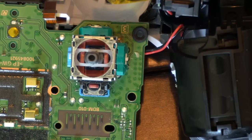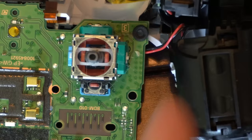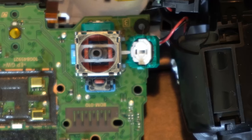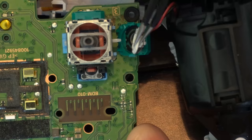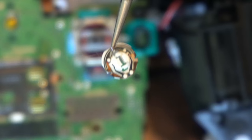I have just this small plastic guitar pick-looking thing that is great for creating some separation and opening this up. I'm just going to put it inside here on the side — you want something very thin. This is peeling off and may be a little bit difficult. Try not to peel it back too far because you don't want the soldering to break on the other side. That came off relatively easy. Now this is the piece we want to lift out and clean — this little sensor right here. So let's grip this and take it out. I can see there's some hair on there, but I'll show you the correct way to put this back in.